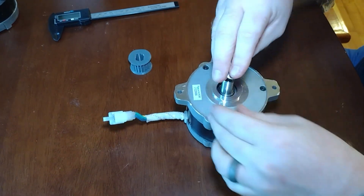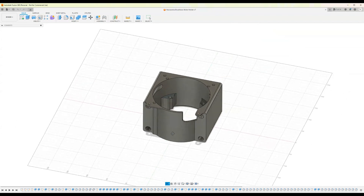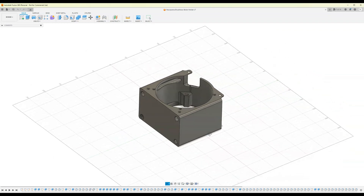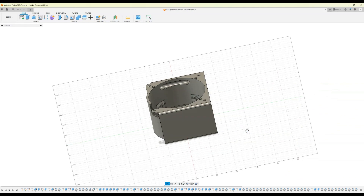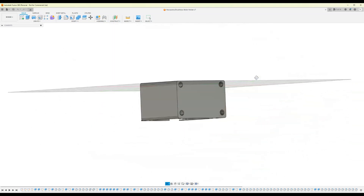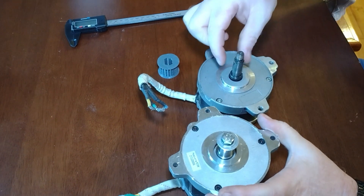I also have a 3D-printed motor mount that holds the motor. On the top it has fittings to allow either a 120-millimeter or 140-millimeter cooling fan. Inside there's a place to bolt in the motor — the motor comes up from the bottom. There's a cutout for the wiring to come through, and then long bolts go through to secure it to the back of the tractor. I'll show how to do that in another video.